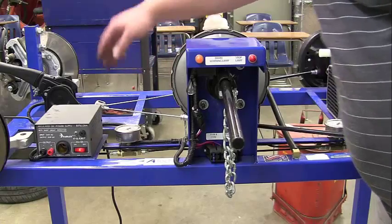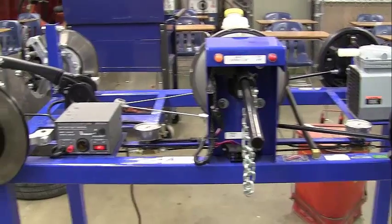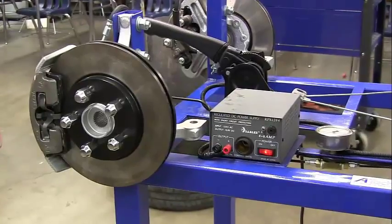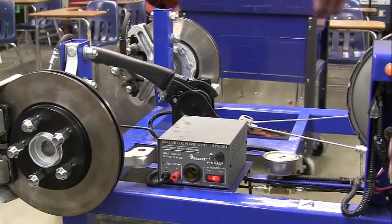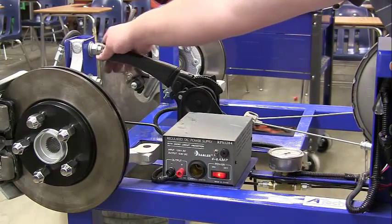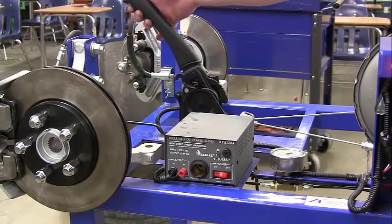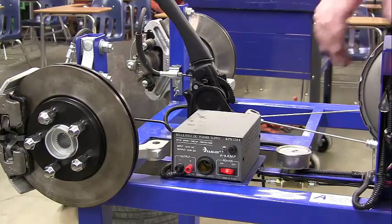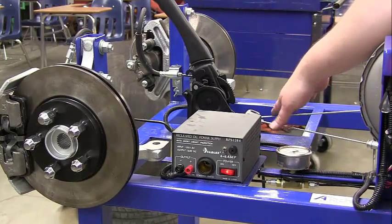The other thing you want to do is pull the handle from the panel. Pull this handle and it should only go up about seven or eight clicks — about two-thirds of the way. But this one goes one, two, three, four, five, six, seven, eight, nine, ten, eleven, twelve. That's way too far, which indicates our parking brakes are not adjusted correctly.